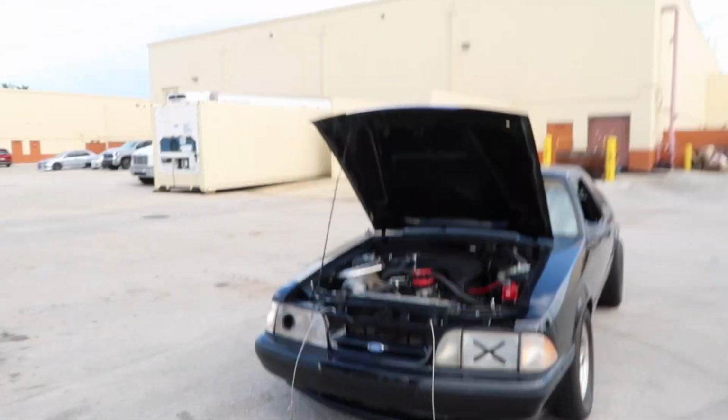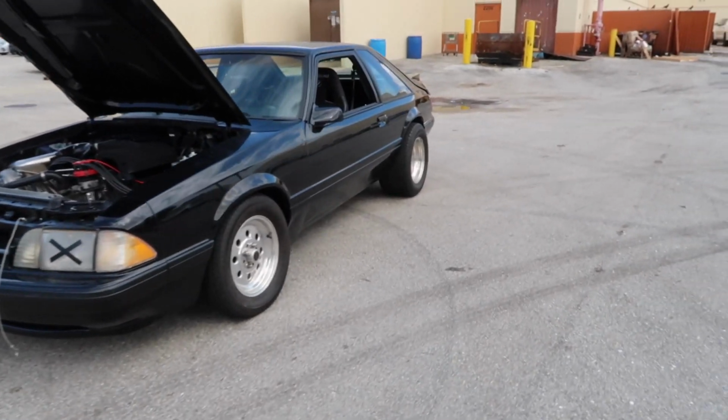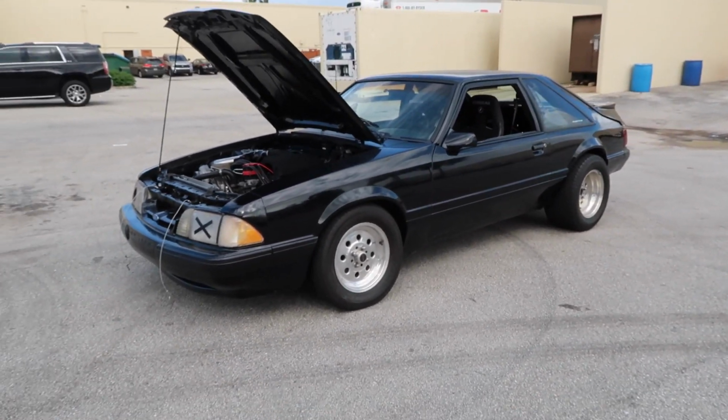Holy shit, am I right? What do you guys think? Last time we took the car out before the fuel injectors, that's how I know she's getting more fuel, because she would spin second, but as soon as I put it in third, it wouldn't even try to spin. And now it blows them out like it's insane, and they're aired down right now. So technically we should have more traction, and she's still blowing the tires loose.